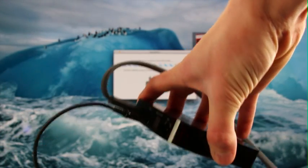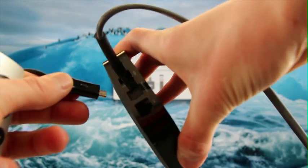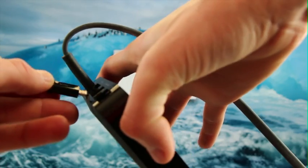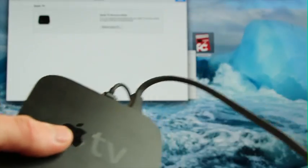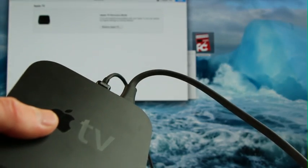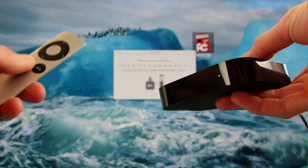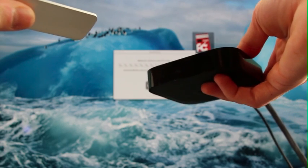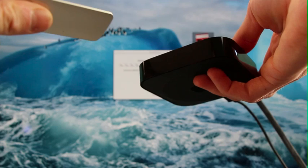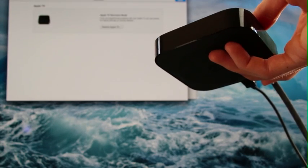What it wants you to do now is plug in your Apple TV. I have the micro USB cable plugged directly into the micro USB port, which is found below the HDMI port, and I also have my power cable connected. If iTunes pops up, you can go ahead and just minimize it. Once you have your Apple TV connected to your computer, you're going to use your Apple TV remote and hold down the menu and pause play buttons together for a total of 7 seconds. Once that 7 seconds is up, the indicator light on the front of your Apple TV will begin flashing rapidly. Just let go of the buttons, and it will automatically go through the process.